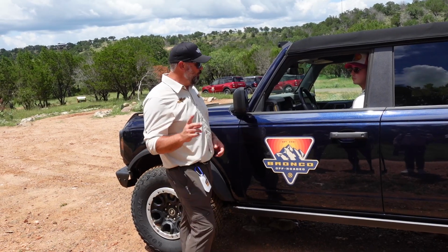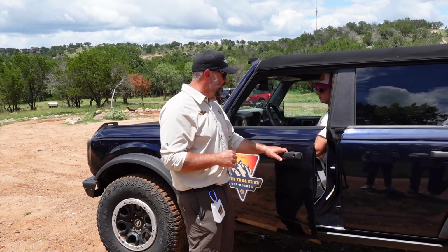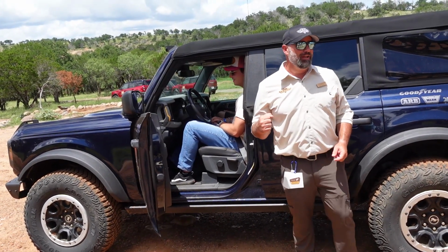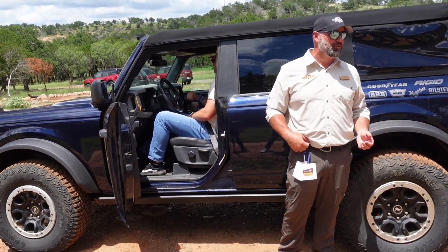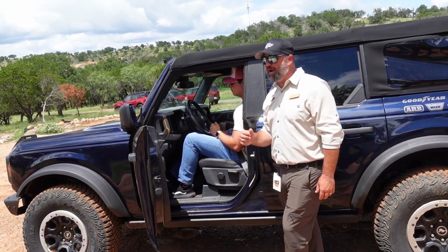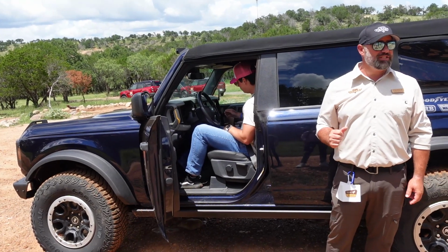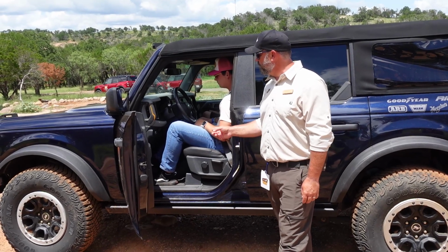Put it in neutral. Before we even do that, we want to reach down, and I want to open this door just to show you this. We don't need to jerk it up like the old parking brakes with a cable. We've had a few of those ripped out of the dash. We want to keep as many of them as possible. So 2 fingers, gently pull it up. Go ahead and do that for me. We're still in drive. Parking brake is now applied. What will you do next? Neutral. Put it in neutral. Once it's in neutral, you take your foot off of the brake. Transmission in neutral, foot off the brake.